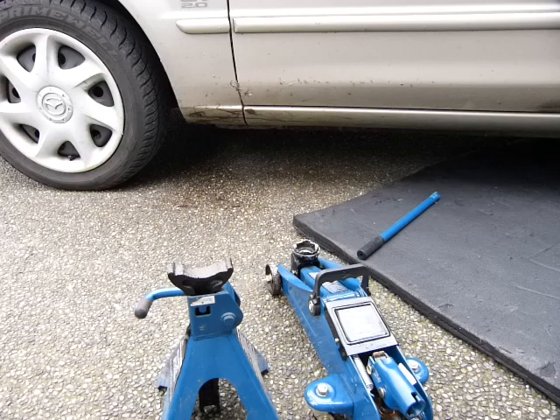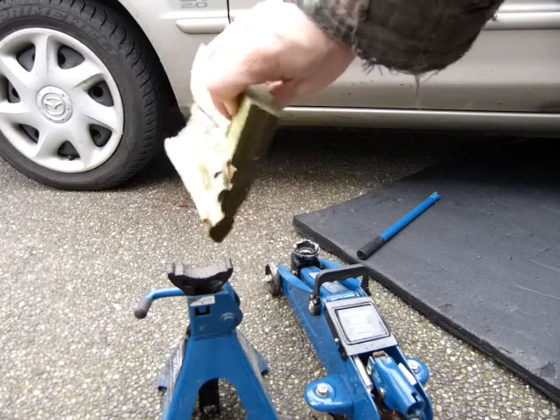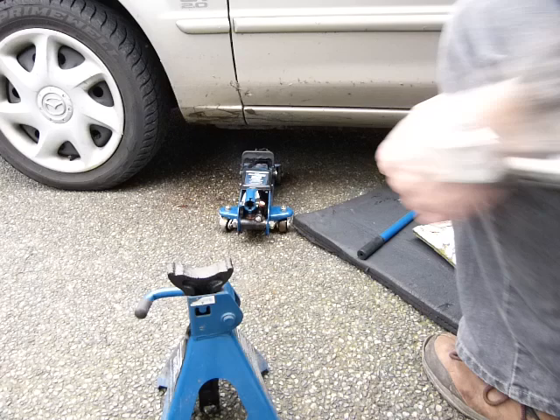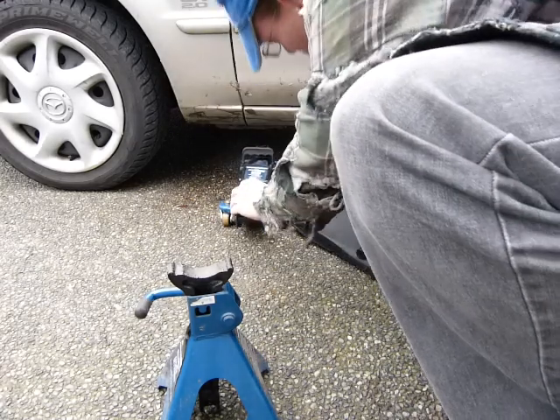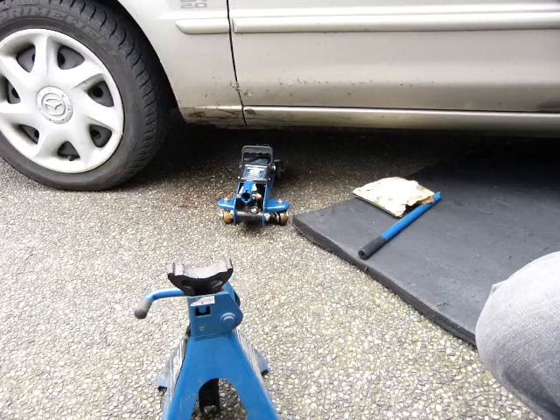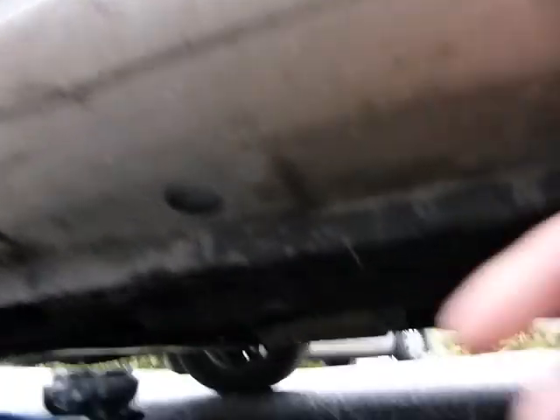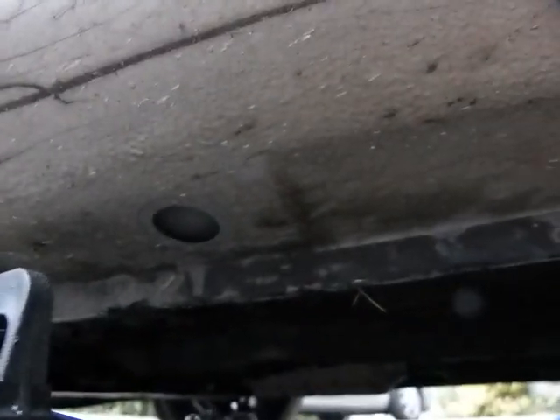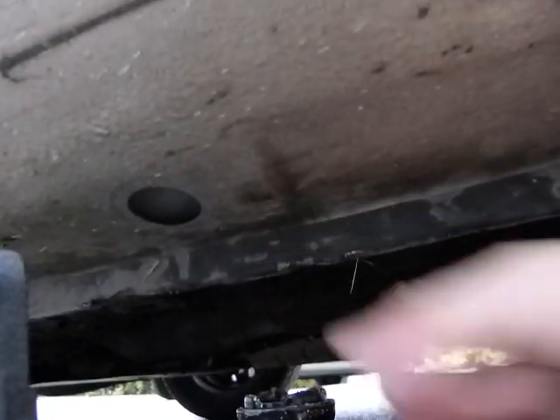Now, once you're done with the inspections, let's do the lifting. For lifting, I use a piece of cardboard or a piece of MDF or a piece of 1x4 — a piece of wood that I put on top of the jack so metal is not in direct contact with the protective layer covering the undercarriage on the vehicle. A good jacking point is somewhere there on the vehicle. Let me show you this metal edge under the car that you should avoid — don't lift the vehicle by this thin metal edge. It's not meant to be, so either lift in front of it or behind it. Just make sure that you miss this metal edge on the vehicle.